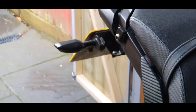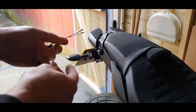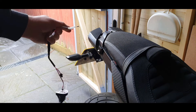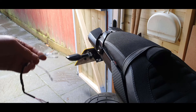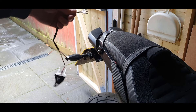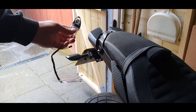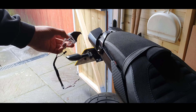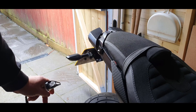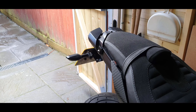They will fit because it's the same housing and the wiring is the same - you've got your ground, your signal that goes to the indicator to pulse and flash, and your DRL live which you pick up from your brake light. There are quick splice connectors so there's no actual cutting and stripping of cables needed. What we're doing is fitting a really good looking bit of kit designed for the front and making it work for the rear - it's up to you. I had five sets and I've only got three left, so people like the idea, but these are concerns I want people to be aware of when ordering them as a set for front and rear.